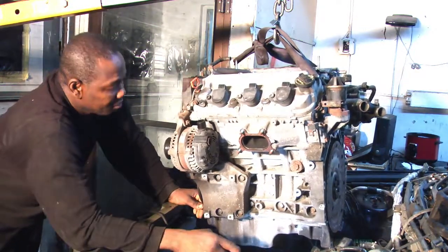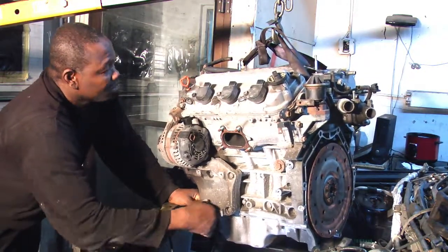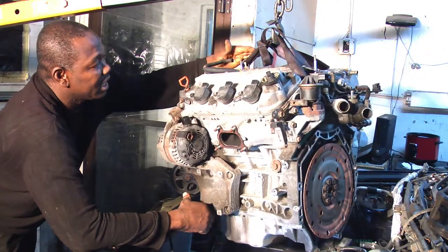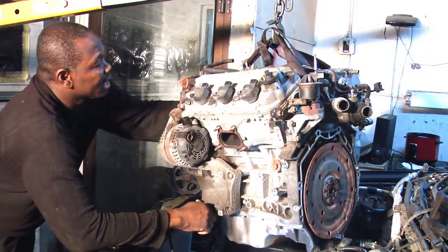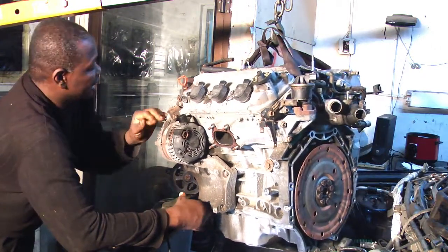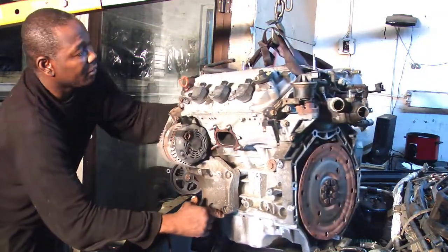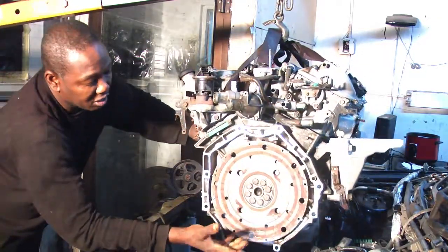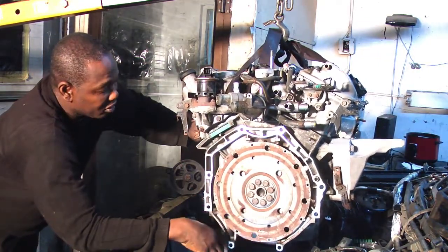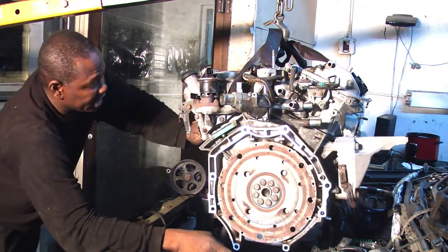The steps to follow for this job: first, remove all your wiring. On this model you have to take out the top intake and the lower intake so you can access the wires. Disconnect all your ignition coil wires, crank sensor, and loosen the drive belt. Also loosen the AC compressor. The power steering is here, and at the back of the car it's bolted to your torque converter. You'll need to release the torque converter and go underneath the car to address the engine mounts, hoses, and electrical wires.